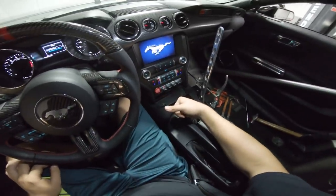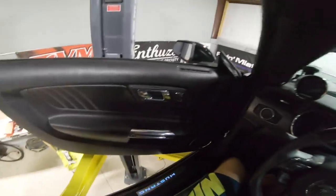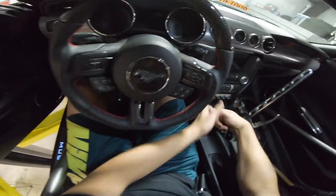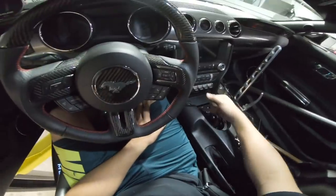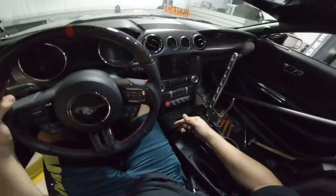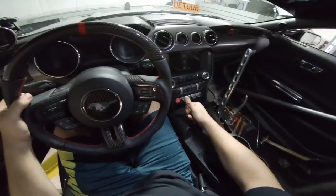First. I don't have a second. Harry, I don't have a second. Nope. First. It doesn't go to second. I want to break it. First. No second. Third, fourth, fifth, sixth. I'm going to have to start the car to try to get the synchros to turn. I'm thinking maybe it's just locked up and not wanting to go in second because of that.